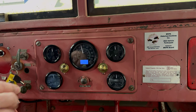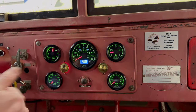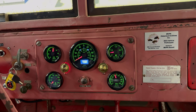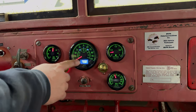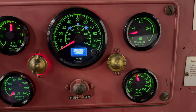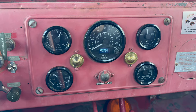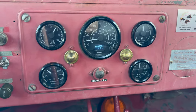Once I run a wire from those two in through the firewall, I should be done with my gauge installation. Let's take a look — I think I have everything wired up. Let's turn the backlight on. We can see our volts are working, our fuel gauge is working. I'm inside so I'm not going to get a satellite right now. Let's start the engine. Oil pressure is working. I'll have to take it outside and let it warm up before we can see if the water temp works and if the speedometer works. But it looks good.